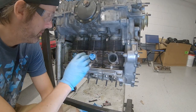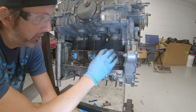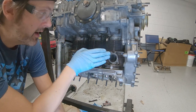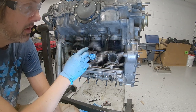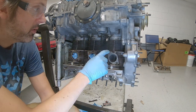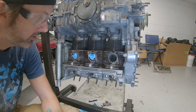When I removed the shorty header, some of the studs came out - not really a big deal. What I did find that I wasn't happy about was that this cylinder had double-stacked exhaust gaskets and some sort of inserts that aren't flush with the mating surface. That means when I put the header on, this one would be sticking out more than all the others. I want to get this to be planar with the other two exhaust surfaces. I'm going to dremel this because I really don't want to snap any of these studs - that would be a huge ordeal. I'll dremel this flange off until the exhaust gasket sits flush against there.